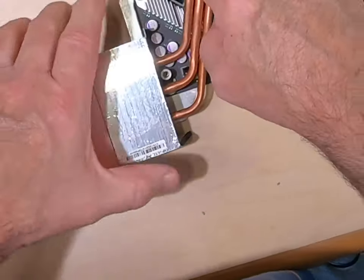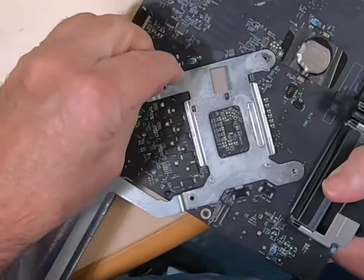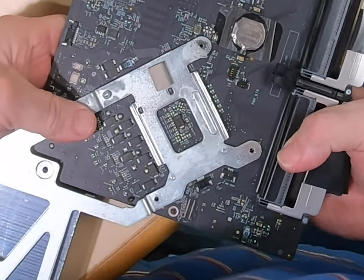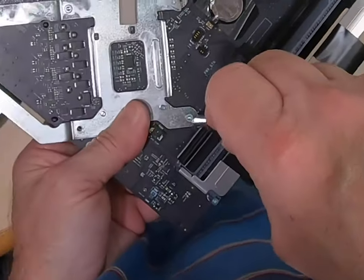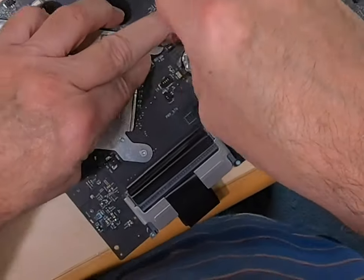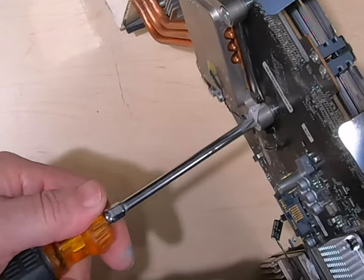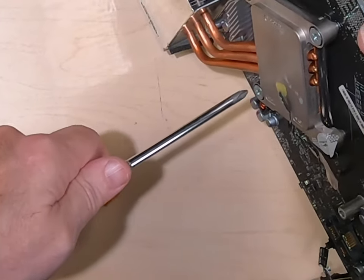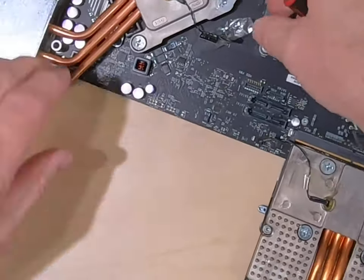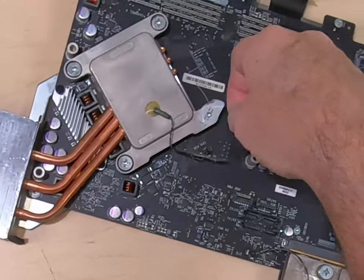Now this is a horrible setup and we have to put those screws back in back here. Get them started with the T7. Now I'll just make sure they're kind of snug with this bigger screwdriver. We don't have to overkill it, but I just want to make sure they're all down. We always do a cross tightening. And then don't forget the jumper for the heat sensor — that will tell us if we're overheating.